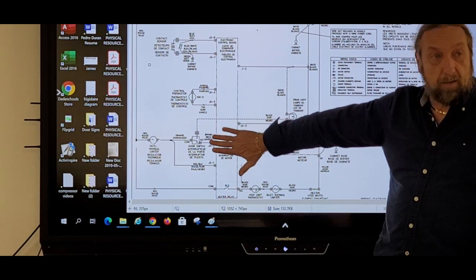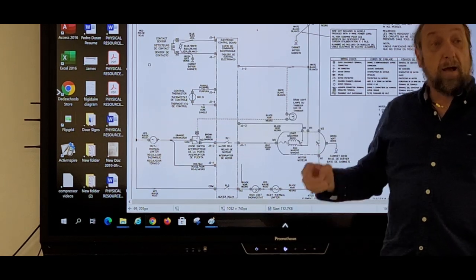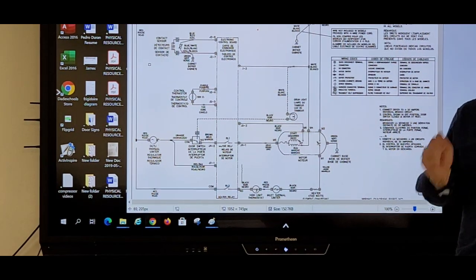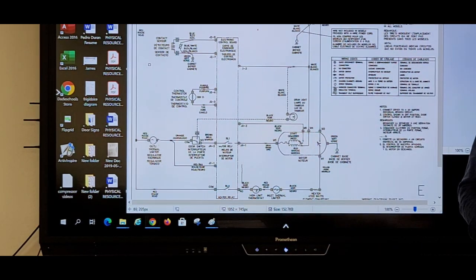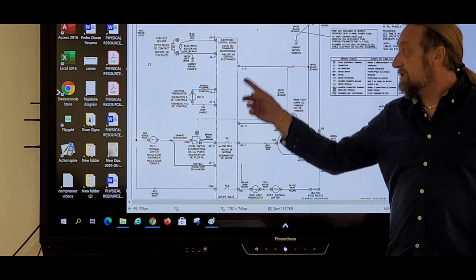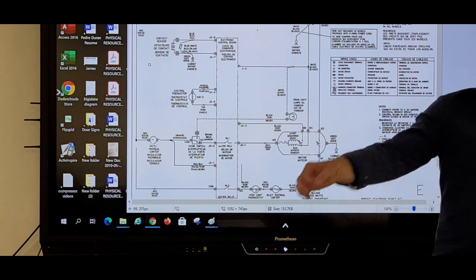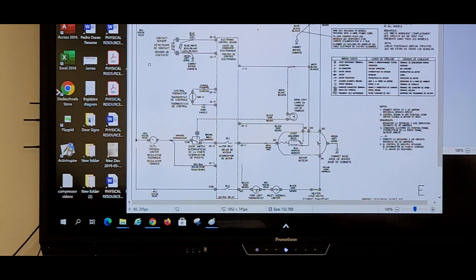Nothing wrong with this relay. Okay? Because I'm not getting power there, I still need to see if the relay is working and the motor's working. So where do I put my jumper wire and how do I jump it? Okay, whatever the two wires that go on the door switch, you take the jumper wire and you put them on those two prongs. I could go to the door switch and jump them, but I'm already here doing these tests on the board. Why do I want to go down to the door switch? Can I do it from the board? Yeah. Where would I be on the board and how would I jump it?